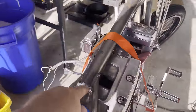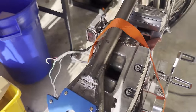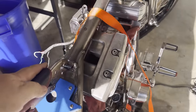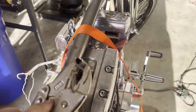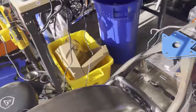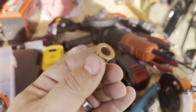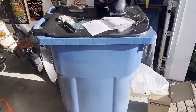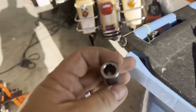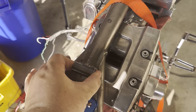The other thing I'm doing is changing out the tube that the screw goes through on the bracket that holds your seat on. This had one already from Paco, welded on, but it's small diameter. I ordered a bracket for the seat pan that Brynn's going to make from Lowbrow. This is the bracket that'll mount to the seat — she'll rotate like that. It also has nice brass fittings to go into the new pivot point. It's quite a bit larger and beefier than what was on there. So I cut off the old one, ground it smooth, and this guy is going to go right there — I'm going to weld that on.